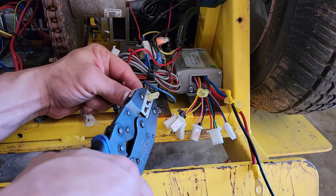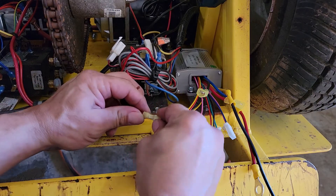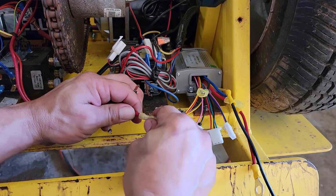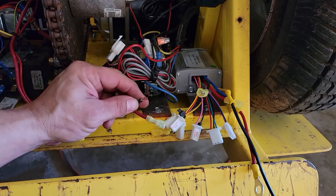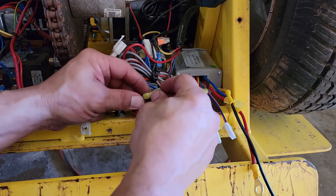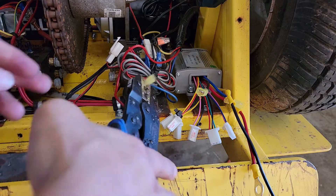You have to be very careful when you're doing this — this is a very critical connection and there are a lot of amps going through here. You have to make sure it gets a good connection. Do a pull test, which means pull on it as hard as you can. If it comes off, we have extras in the kit. Make sure you're not crimping down on the insulation — you need a good solid crimp on the wire itself. If these connections aren't good, over time you'll get arcing and they'll melt together.